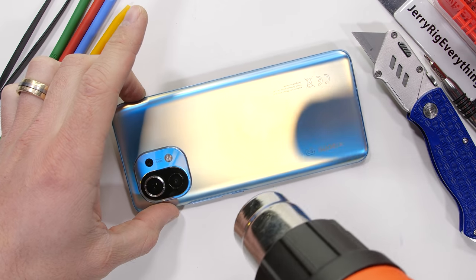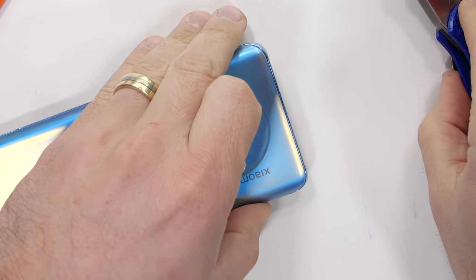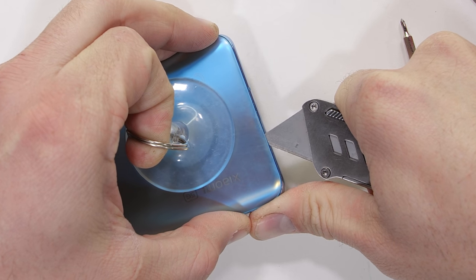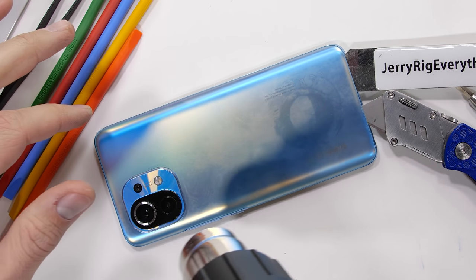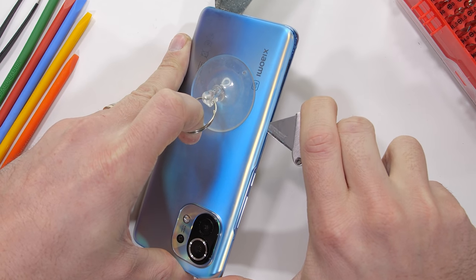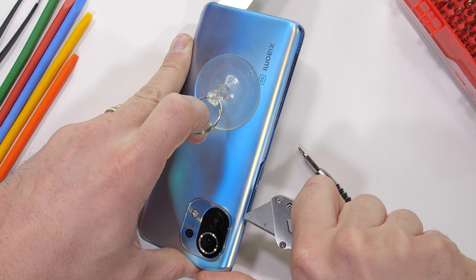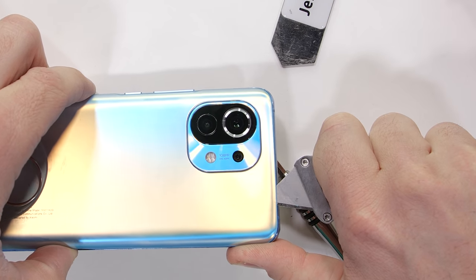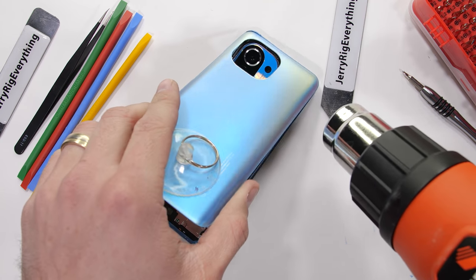In order to get inside of this glass back smartphone, we have to break out the heat gun. The Mi 11 does not have an official IP rating, but it is still glued together pretty tight. The hotter the phone gets, the easier it is to remove the glass. There's a little sweet spot where the adhesive gets loose — right there between being barely too hot to touch and the battery exploding. With a little upward pulling motion on my suction cup, I can slip my pry tool and razor blade in to slice away that soft adhesive.